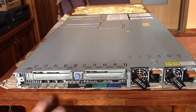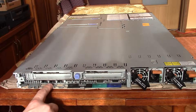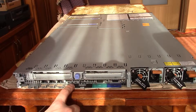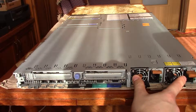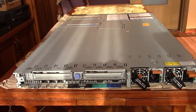On the back, there are two PCI Express x8 ports, two LAN connectors, one Remote Access Manager RSA 2 connector, two USB ports, a COM connector, a VGA connector, and two power supplies. The redundant server can run with only one power supply, but it's better to use two — if one fails, the other can still work.